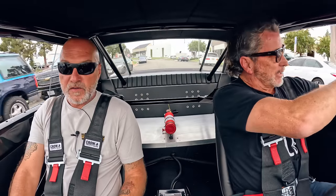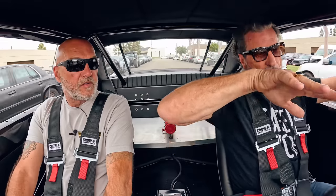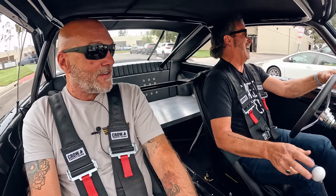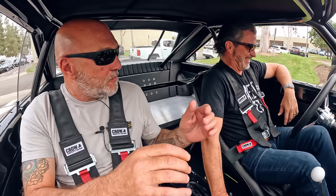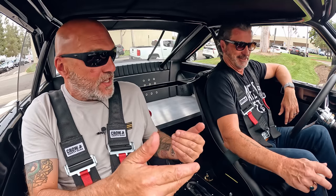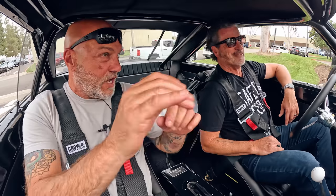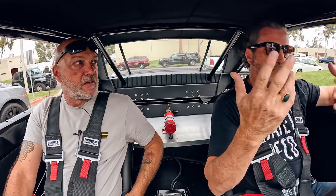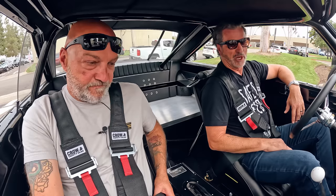When I took it to the upholstery place we backed it off the trailer — the ride height was dialed in really low — and it had a drainage gully through the middle of the driveway, so the car kind of bottomed out. That was actually a battery issue we'd had before. We think there might be a slight vampire current from the alternator draining the battery, but once you put a charge on it, it fires right back up. A lot of people watching don't know what it's like — they think the car's built and you just drive it like a brand new Prius. No — you find little things over 500 to 1,000 miles until it's right. It's a fresh build. Just a couple of little tuning things.